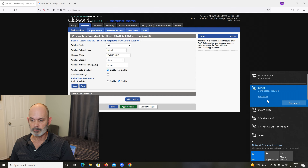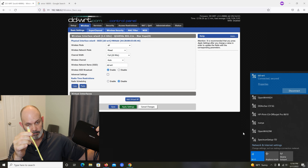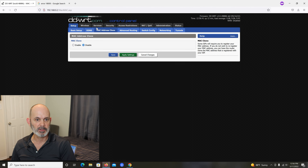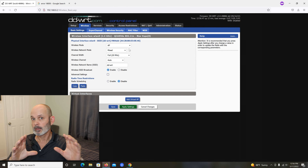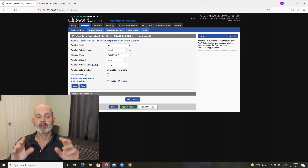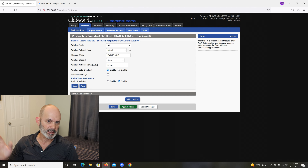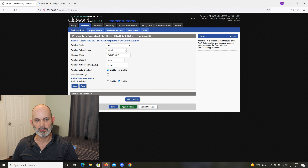Say Yes to the connection question and I'm connected. If I disconnect my wired connection from the router I'm physically connected to, I'm still connected through DD-WRT wirelessly — I can still browse through it no problem. Basically at this point we are done — we've created a five-port switch with an access point that you can connect to your network. If you don't want the access point, please still configure it with a password just in case something messes up — that way nobody can hook up to your Wi-Fi. To turn it off, go to Wireless Access Point and set it to Disabled.